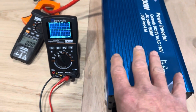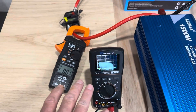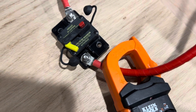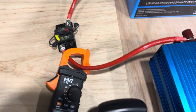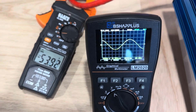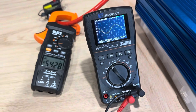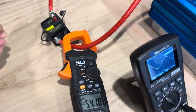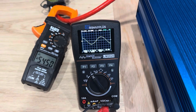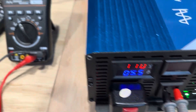I've got the experiment set up one more time, a little bit different. Still got the inverter killer hairdryer, got the pure sine wave Alpha inverter back on. Oscilloscope and amp clamp set the same way, except I changed the breaker from 100 amps down to 30, because I want to trip the breaker — I want to see how long it takes in an overload condition to trip that breaker instead of just popping the BMS. 30 amp breaker, 50 amps... starting to get kind of warm... should go any minute now... there it went.